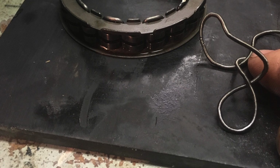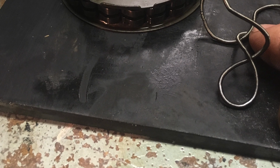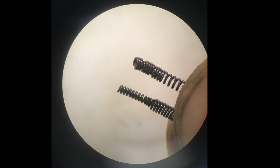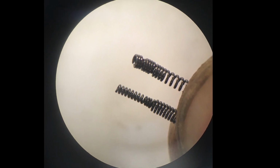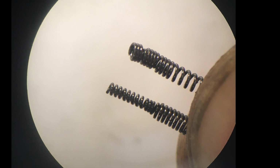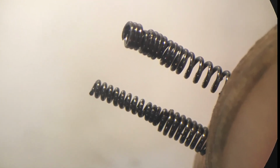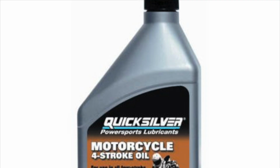it back into itself. And when you do that, by the way, when you're putting the spring back together, before you actually thread into each other, counter spin it about 5 or 10 times. That way, when you connect them and you splice it together and you turn them and thread them into each other, it's not all twisted at the end. So that'll help you get a better spring.